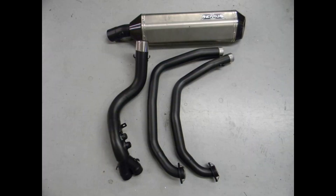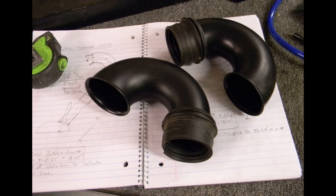The entire Remus exhaust system was ceramic-coated black for performance, safety, and ease of cleaning. Now comes a whopper of a project — we're going to redo and re-engineer the airbox on this motorcycle. On the current airbox are these intake tubes, and this length of intake tube gives us high horsepower only at high RPM. What I plan to do is create longer intake tubes that give us more torque. We'll take a hit on horsepower, but we're going to gain torque, and torque is fun.